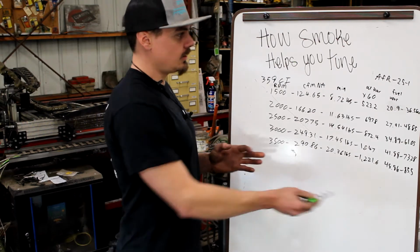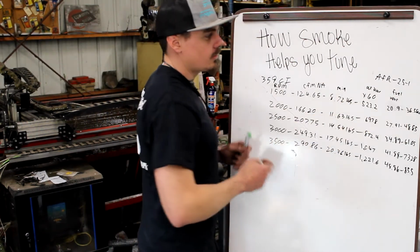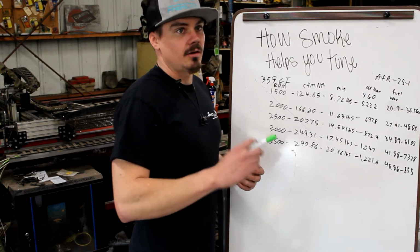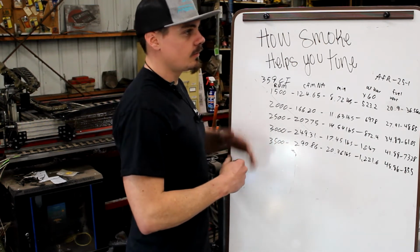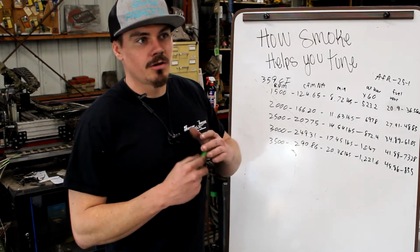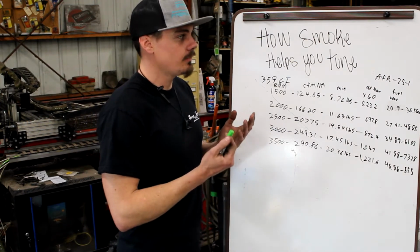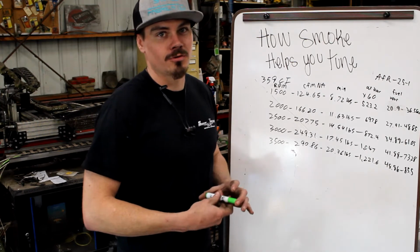But the bane of diesel itself is the fuel type. We've talked about AFRs quite a bit. Diesel has an AFR that's infinitely high. Essentially, it'll go up and run an AFR as high as we can get it to. There's a point where the power production is so low, because we pulled fuel out to make AFR go up, that the piston won't accelerate and isn't producing torque.